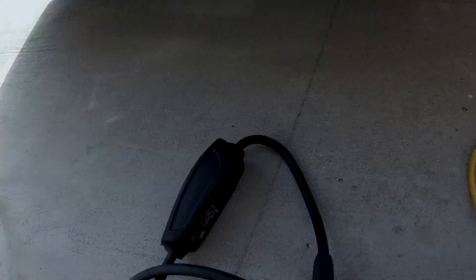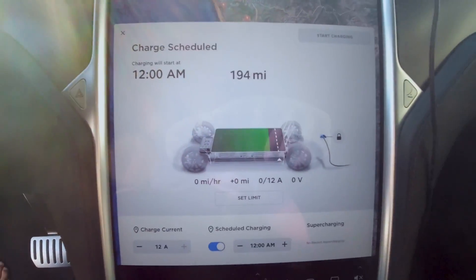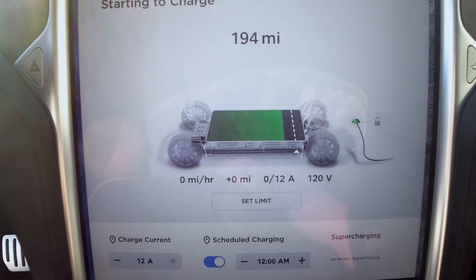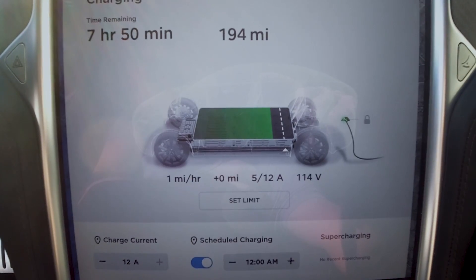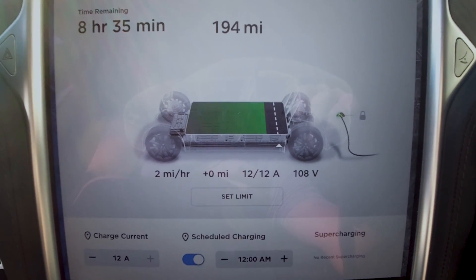Let's do the same thing. I'm going to unplug this. Unplugged. And now I'm just going to plug the Tesla charger into one of the wall outlets directly. Okay, so it's in the wall. Now I'm going to try one more time just to show you what it would normally get. Plug it in. This should go green, or I might have to click it again. Okay, because the scheduled charging is on. Let's go start charging. Starting to charge. One, two — two miles per hour, 108 volts.